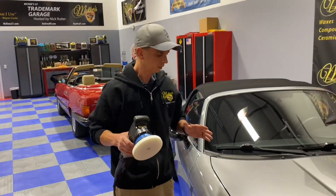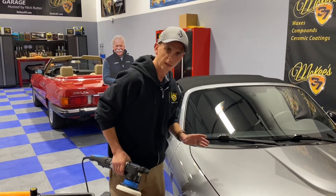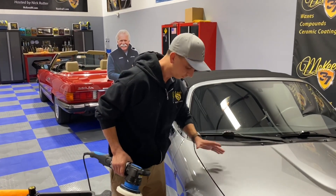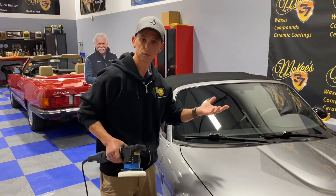What that stroke means, or the millimeter, is the size of the orbit for the pad — the stroke of the tool. The larger the stroke, the larger the orbit, the more area, the surface area, the tool covers.